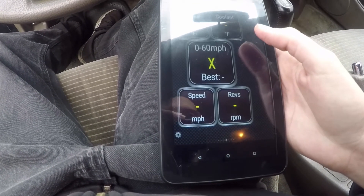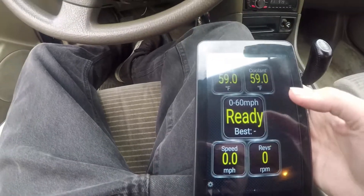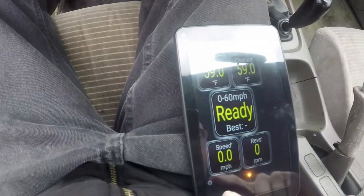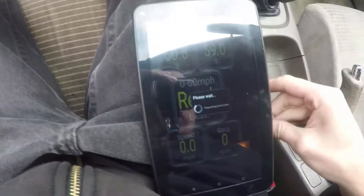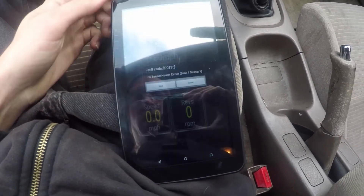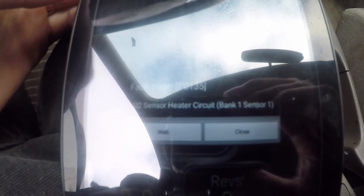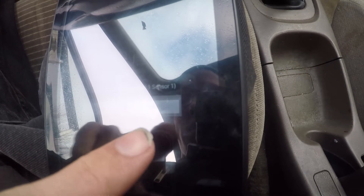We're going to do some poking at the codes. There are two OBD codes. I have two O2 sensors in this vehicle and I need to find out which one. Show log fault codes — which is P0135, bank one, sensor one. Okay, so it's the front one. There's not a lot of purpose in playing mix and replace if this was going to be bank one sensor two or whatever. Basically if the code has a two it's the rear one, if it's one it's the front. Most likely.